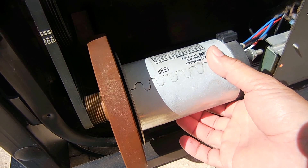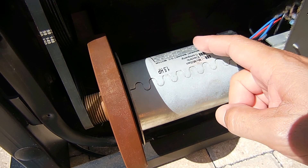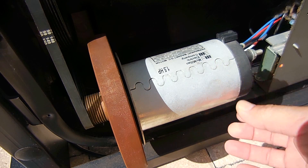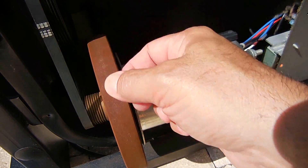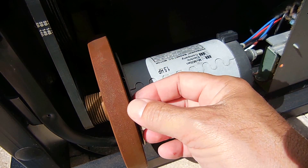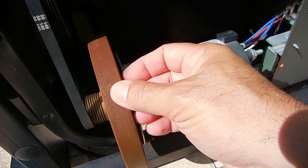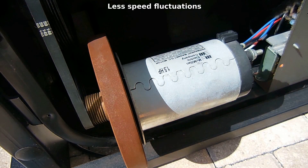This is the permanent magnet DC motor, made in Logan, Utah. It's a 12.1-amp, 6400 RPM motor with clockwise rotation and insulation class F. I'm going to save this for other projects. It has a very heavy cast iron flywheel. The purpose of this flywheel is that while the motor is running, it has kinetic energy, and because the flywheel has so much mass, it smooths out any variations in speed, giving you a more stable speed while the treadmill is in operation.